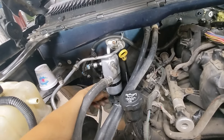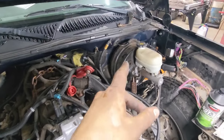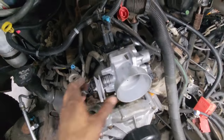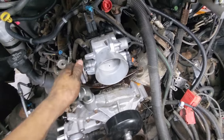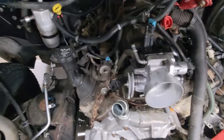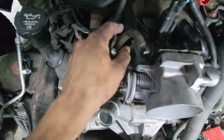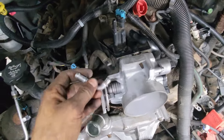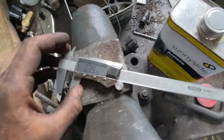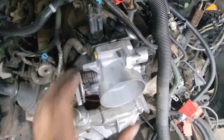The 5.3 was drive-by-wire and the 4.3 was drive-by-cable, so the truck was drive-by-cable. It's really annoying to put a drive-by-wire pedal in there, and drive-by-cable is just better. So I got a drive-by-cable throttle body — they're about $100 on eBay. It had this fitting stuck in here; apparently at some point they changed it, so there's a vacuum line coming out the side of the intake manifold instead of the throttle body. I pulled it out — it's about 10mm in diameter — and found a little rubber plug that fits in there. Since it's vacuum, I'm hoping that's good enough, but I guess we'll find out.